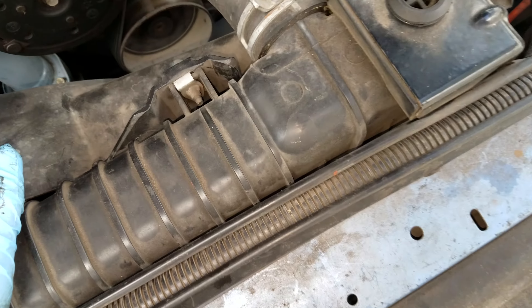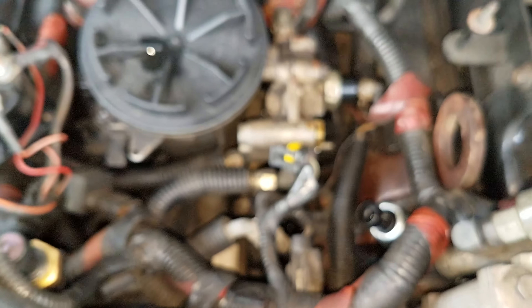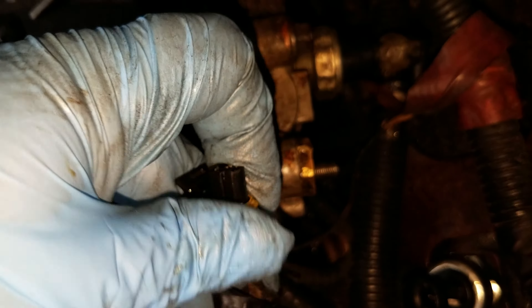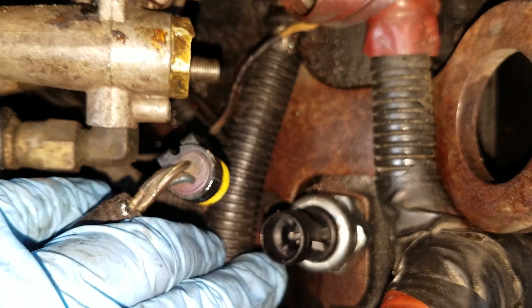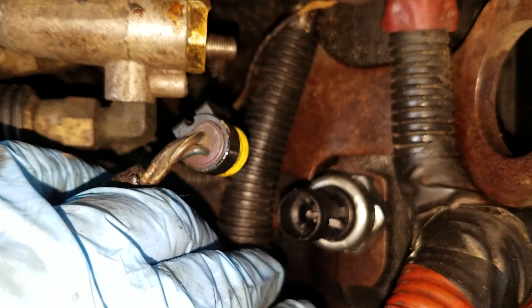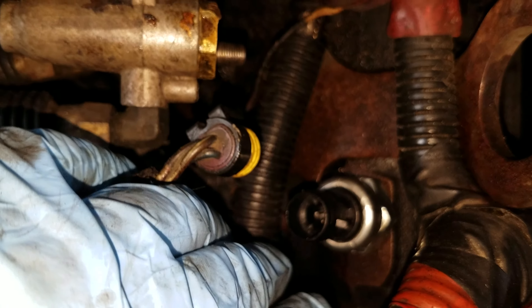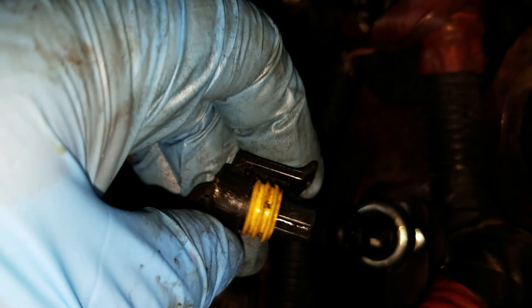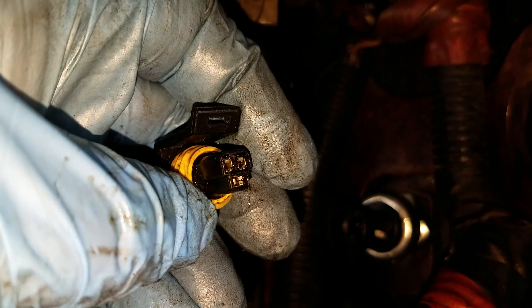I set the phone down and resumed taping once I got the new one in. What I did was take an air compressor gun and cleaned off the cavity to get most of the oil out. There's still a little bit on there, but I got the new ICP in. If you have specialty tools like a crow's foot, I'd definitely recommend it — it's a pain trying to use box wrenches, but it is doable. Just make sure you clean up the plug area really well.